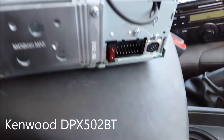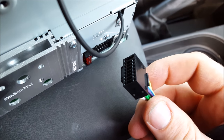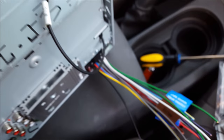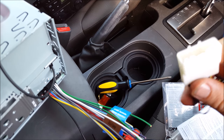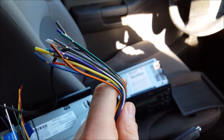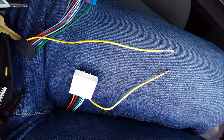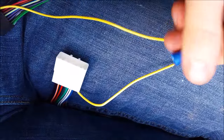Here's the back of it. The OEM connector that comes with the new stereo looks like this. I'm going to put this in here, and then after plugging that in, hook up the wires from the OEM hookup to this. Here's the stereo and wiring kit that came with my aftermarket stereo. Here's the one I bought to connect to the OEM adapters without having to cut too many wires. I'll be connecting these cables corresponding with their colors. I'm taking the matching wires and just using twist wire connectors for these two.